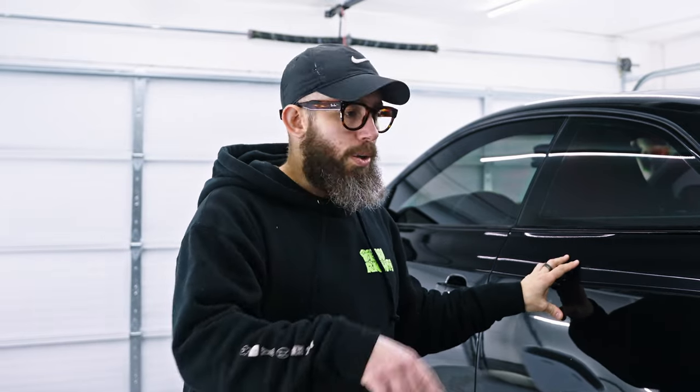As you can tell, the car is up on the lift. What we're gonna do now is go through the process of paint inspection — we're gonna look at the paint, check all the way around, and make sure we know where the deep scratches are, where paint chips are, and where the fill-ins are. We always want to keep a mental note of where these things are so we're well aware of what's going on in the paint. That's why we inspect the paint first, then measure the paint depth.